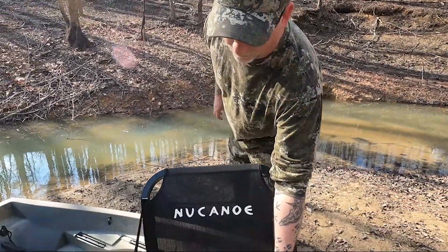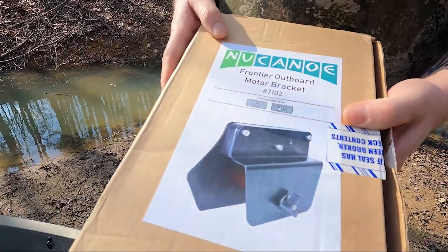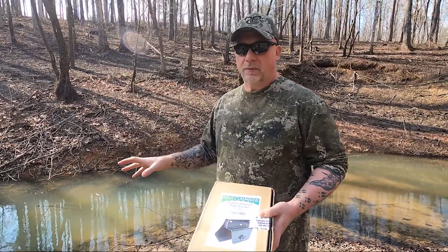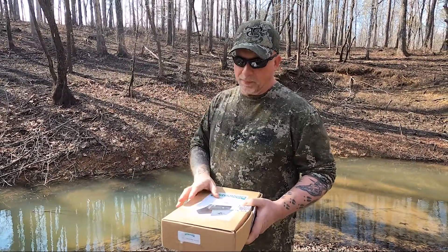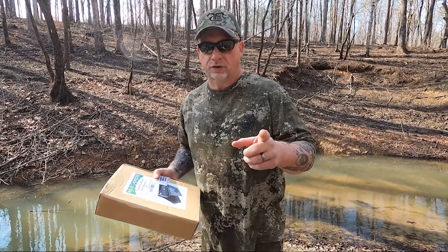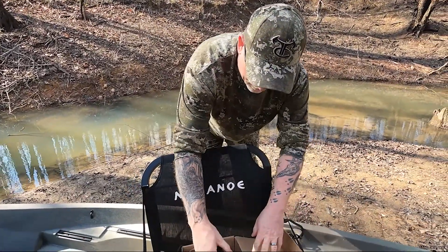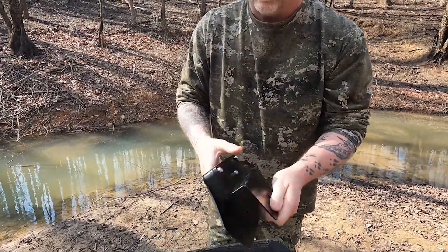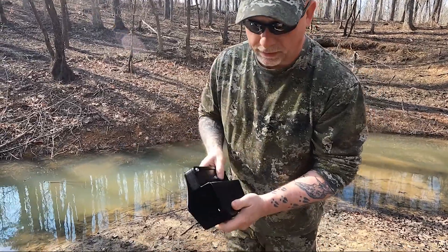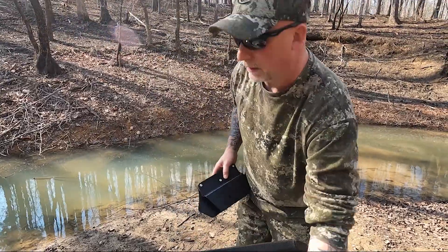It's the 7102 kit. You have to purchase these and they run about 90 bucks, but what it does is strengthens the rear end of the boat so you can put a motor on there and not damage the back. You're going to need an 11-millimeter wrench to do this, but it shouldn't be too complicated. It's a good steel bracket — adds a little bit of weight, but that's going to give you the support you need to take care of the back end of this NuCanoe kayak.